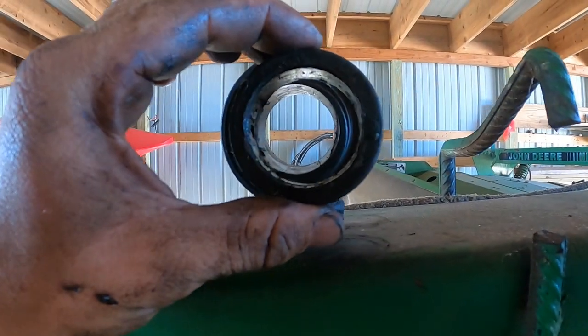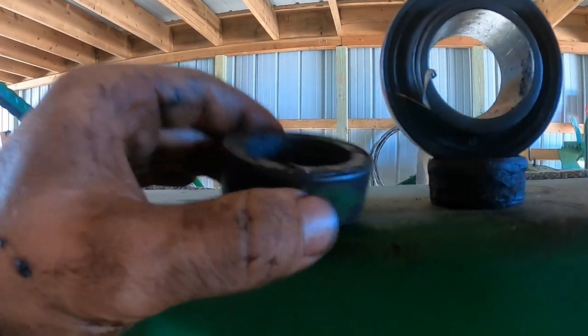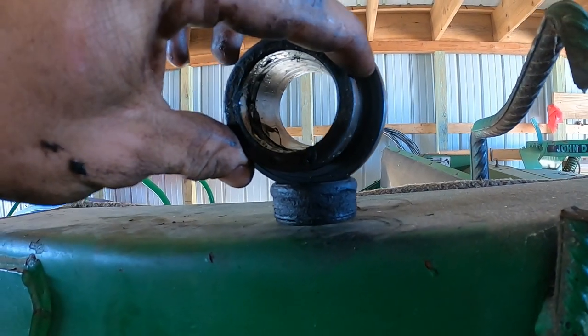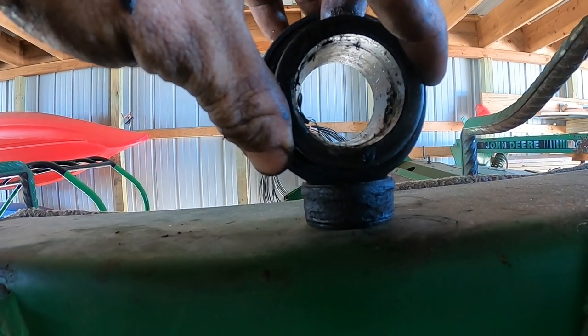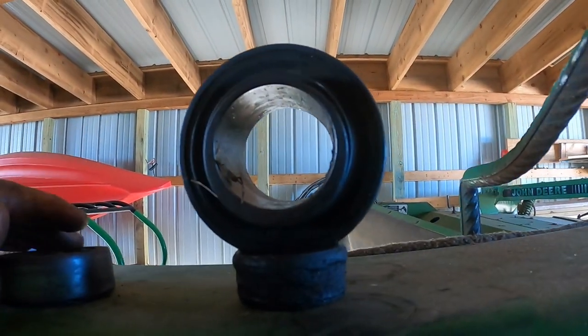It's designed like that because this collar right here will make it to where, if it wasn't missing the piece on the top, it broke off. It's basically designed to set this on here and then you twist it. And as you twist it, it'll make it to where that offset is pushed tight against the bearing. It's a weird design, but it's how it was designed by Kuhn. And I mean, it works good.